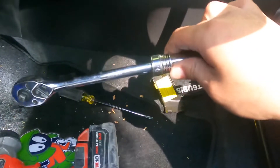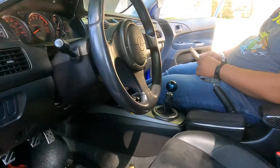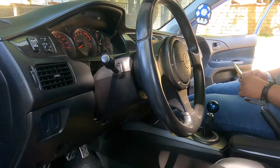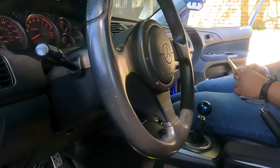Use the ratchet — it's pretty tight so you're gonna have to use some force. But before you do anything, remember to disconnect the battery so the airbag doesn't blow up. The wheel has to be straight so when you remove it you won't have any alignment issues. Once you loosen that bolt all the way, it doesn't come out — it just stays loose.